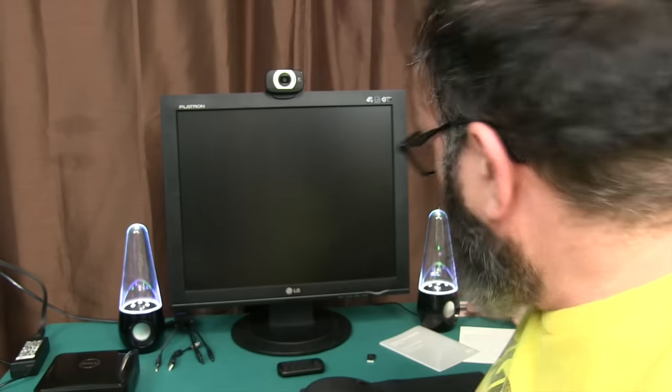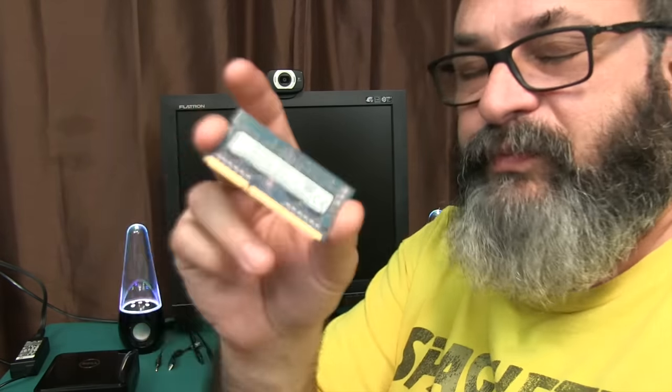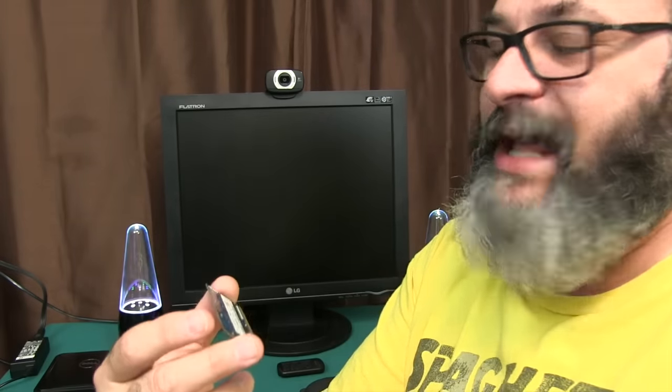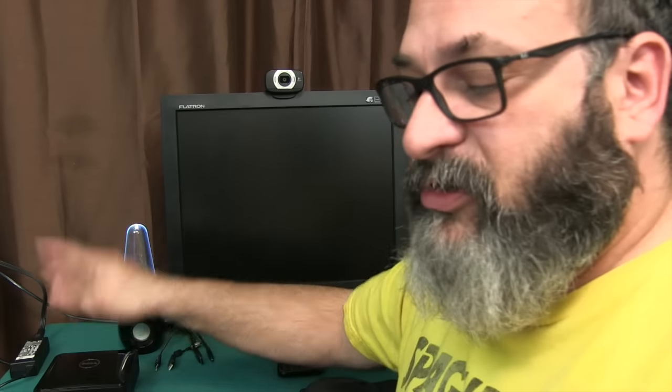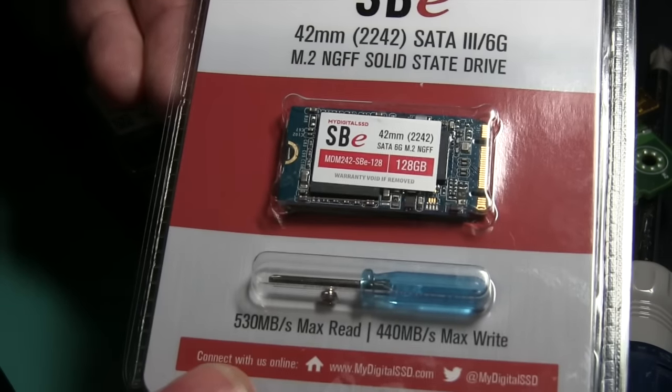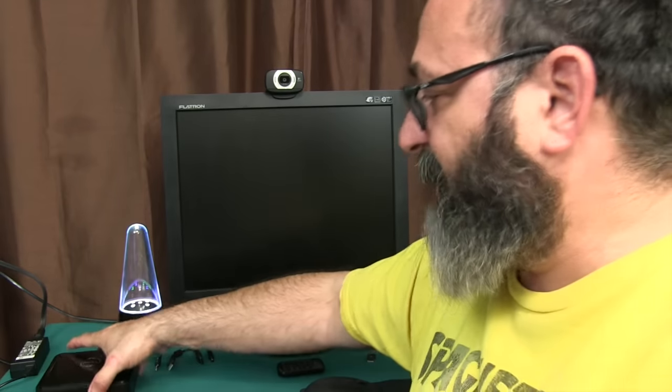I took the 32GB hard drive out and replaced it with a 128GB hard drive. I also replaced the RAM — it came with 2 gigs. It uses a laptop-style DDR3L, the low-voltage type of RAM. All specs are in the description box. I put the link to the solid state drive I installed — a 128GB M.2 drive made by MyDigital, $52.49 on Amazon. I also replaced the RAM with 4 gigs by Kingston, also on Amazon, for $20.99.